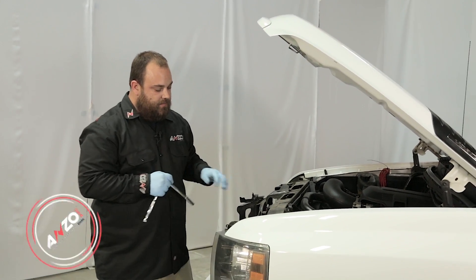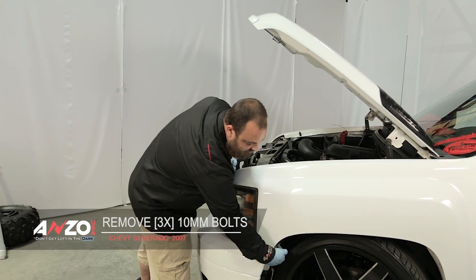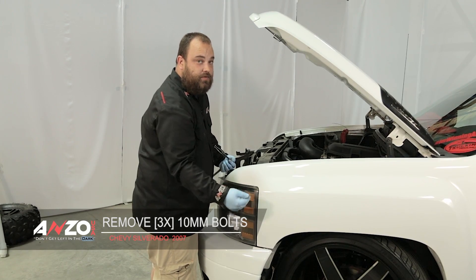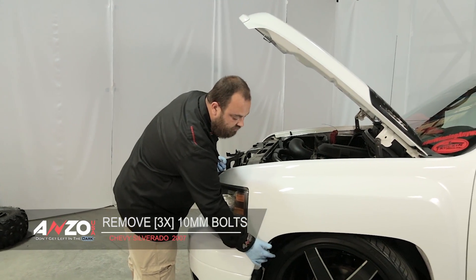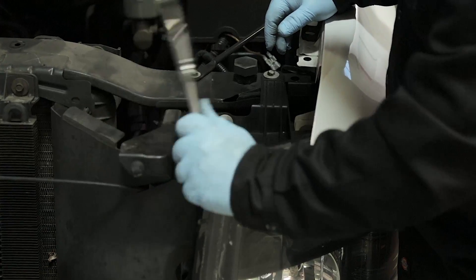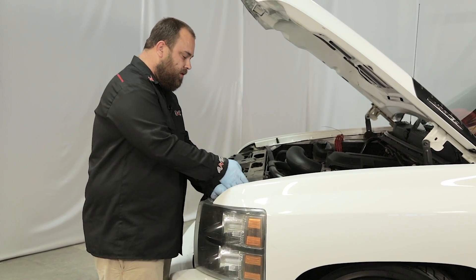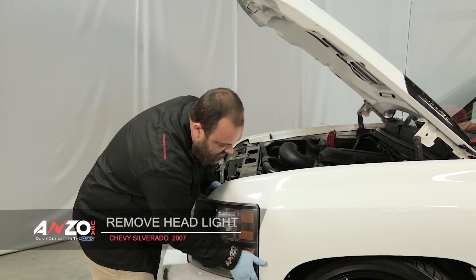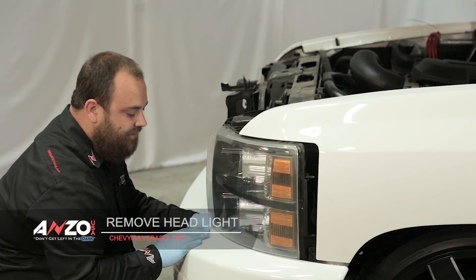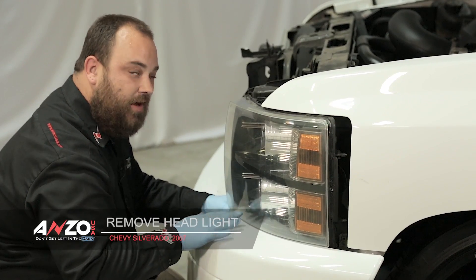Now that we can take off the headlight, we have three bolts — one here, one here, and the third mounting location is on the bottom. On this vehicle there's no wheel well liner, but on some you will have two bolts to pull down the wheel well liner so you can access the lower bolt. Once you've removed the three bolts, you can go ahead and remove the headlight. This can be a little tricky — just wiggle it and slide it out. If you have a good paint job, put blue tape down here before removing so you're not scratching anything.